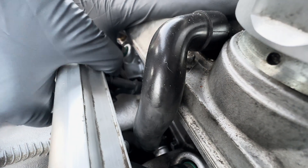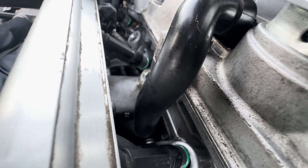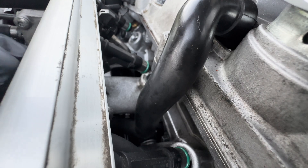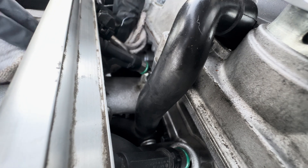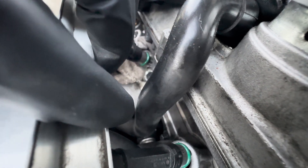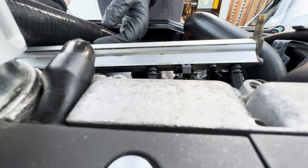It may seem kind of brutal and strange, but the way you're going to remove this fuel line is just by pulling it. As you can see, I didn't put a rag and I just had fuel leaking all over my engine, then had to run and find the rag - so put that there first. Once your fuel line and all your electrical connectors are removed, you're free to remove the fuel rail. If this is your first time removing it, it's probably going to be a little bit stuck - put each hand on each side of the rail, apply even pressure and pull, and it will most likely pop out.